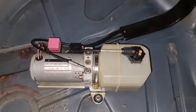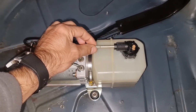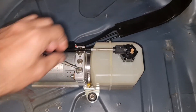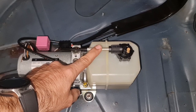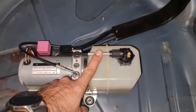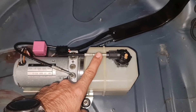This is pretty easy to check if you have a pump like this. This is the return line from the block and all the cylinders. If we separate this into another clean and clear container and check how the system responds and how the fluid returns to the new container, we can diagnose the issue.